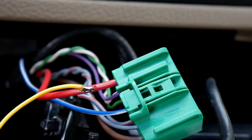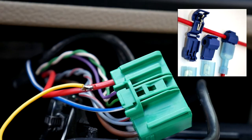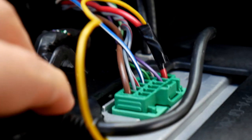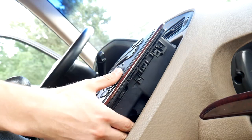We can take the voltage from the stereo wire. Disconnect the car's stereo plug-in so we can do the wiring. I already soldered the power supply wire, but it's also possible to do it with special plugs. When the wire is isolated, connect the main plug-in back into the head unit and check the other connectors to make sure they are in their places. Then very carefully, without damaging anything, put back the middle console with the head unit.